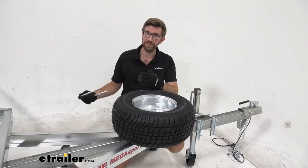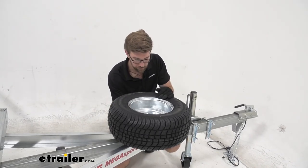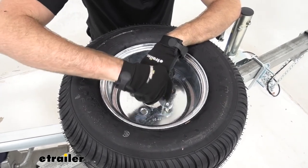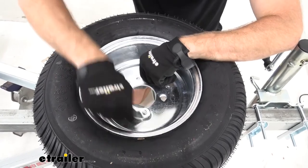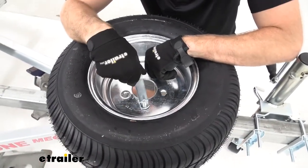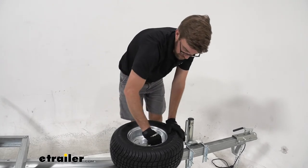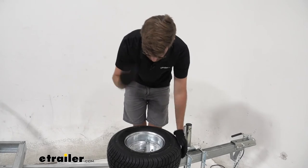Now the last thing we need to do before finishing is get our spare tire put in place. I've got my spare tire sitting up front. Take the U-bolt, fit it from underneath the tongue, get it lined up, and take one of our two pieces — one side is oval to allow a lock to go through, and the other is threaded, so we'll take the threaded one and get that started. We want the U-bolt flush up against our frame underneath, so get it until it's making contact with the rim. We can get the other one started, get those facing one another. If you've got a lock, you should definitely put something on there just to keep the spare secured.